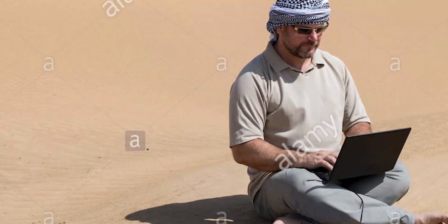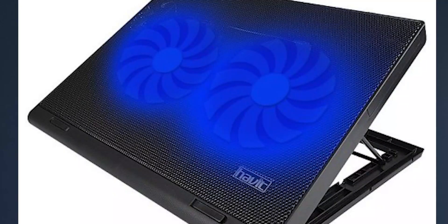On a very hot sunny day, don't use it outdoors. If you are using a laptop for a very long time plugged in, that will create more heat, and you would want to use a fan or cooling pad below it. That will keep the whole system cool and may prevent your battery from bulging out.